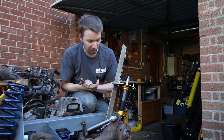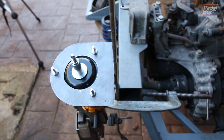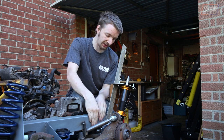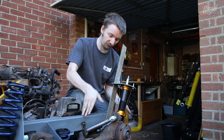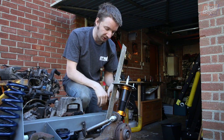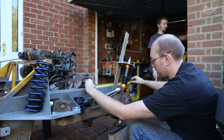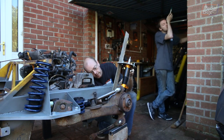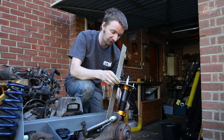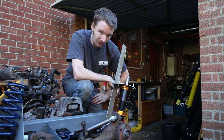We've compressed the suspension strut fully — this is the absolute maximum it could ever be put under, and it's probably never going to reach this. We've put a big chunky section of flat bar in the back to make sure the inside face of the turret top and the outside face of the chassis leg are vertical to one another. Once we confirm that, we can start measuring from the front and rear corners of the turret top down onto the chassis leg to figure out the shape of the plate, and then add the big triangular reinforcements front and rear.